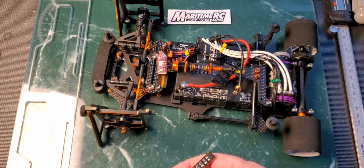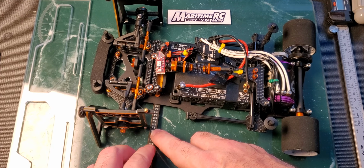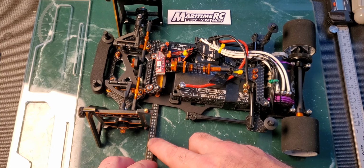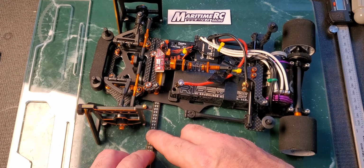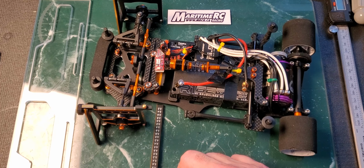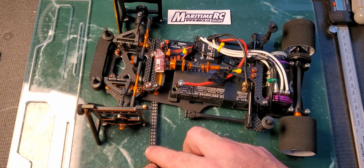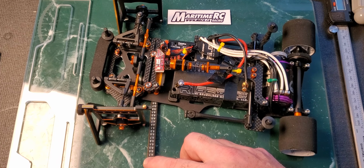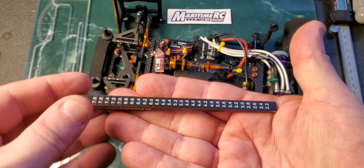So when you're doing your test for your ride height, I'll just pick a point on the car, you set your ride height, make sure that the car is sitting down. You can see that at the 4 millimeter mark, it kind of fetches up. It didn't slide anymore. I'll just do that again. At the 4.2 it's fetching up. Then you can just flip it over and see if it's actually 4.3 millimeters. No, it doesn't go to the 4.3, so it is 4.2 millimeters of ride height. And that's how you use this little guy.